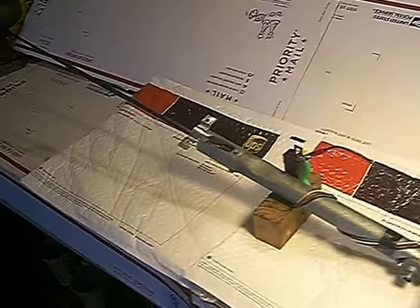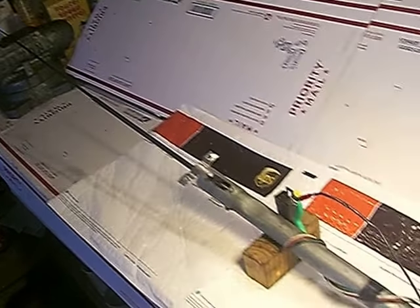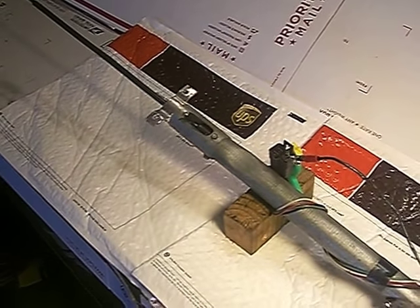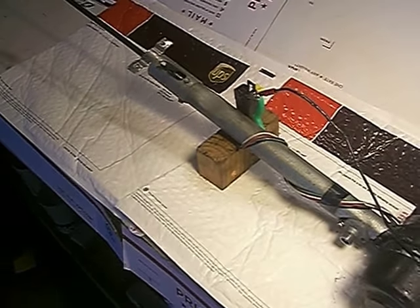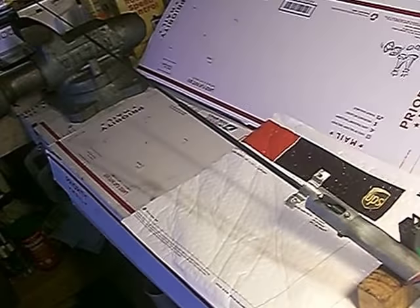of the extension until the limiting switch shuts off the motor, as opposed to the disengagement clutch, which is the design style that ended in 1969. This 4-wire variant from 73 to 76, when the power antenna was reintroduced, has a limiting switch timing mechanism as opposed to the clutch base.